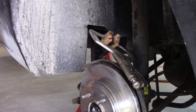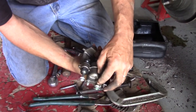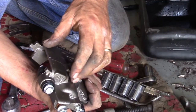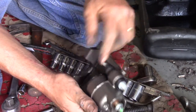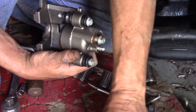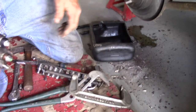So that's what cutting those little blocks of wood was all about. Next we're going to put on the new caliper. You can see it here — it has two brand new copper washers, a brand new banjo fitting, a brand new bleed screw, and brand new bolts to hold it on. The rebuilders aren't going to care if you keep the old hardware — those items plus the copper washers don't take up much room and might save your butt someday.